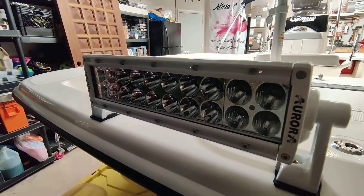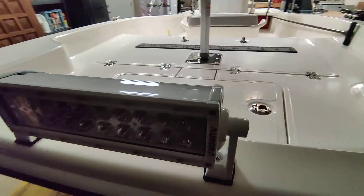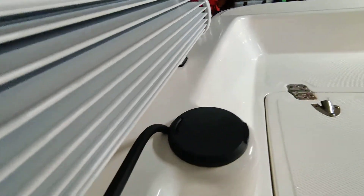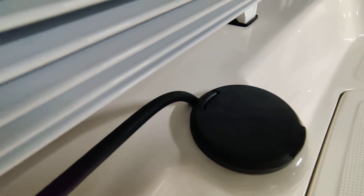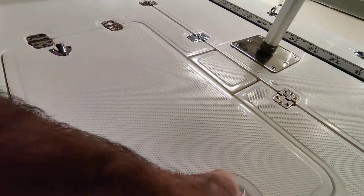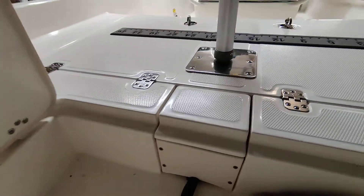The light is pretty nice and sturdy. Comes with brackets, rubber bushings for mounting it, and a nice long harness. The way I installed it on this one is basically notched out a little hole where the nav light is, and then ran the wire down through it. And it pretty much goes in with the rest of the wiring all the way through.